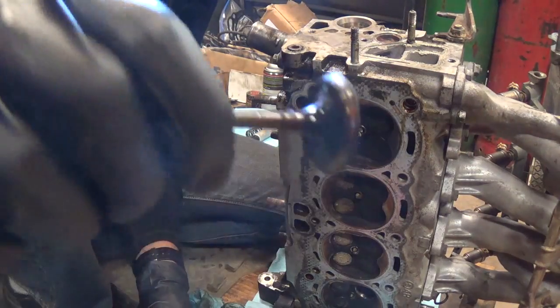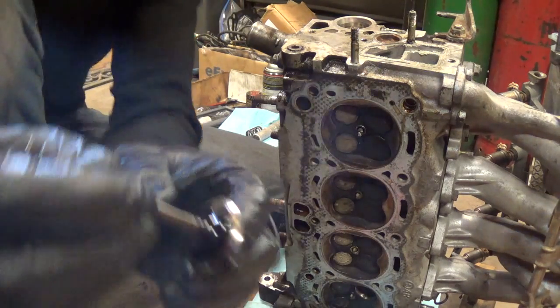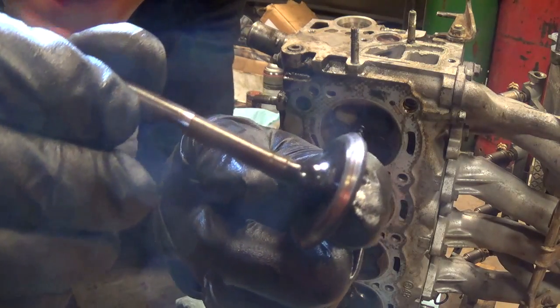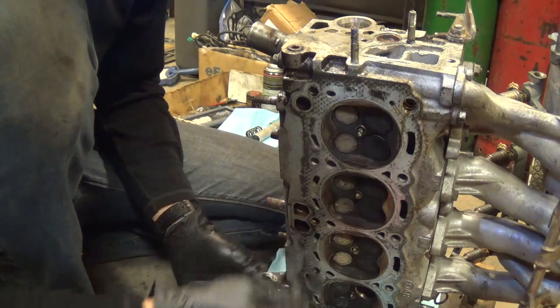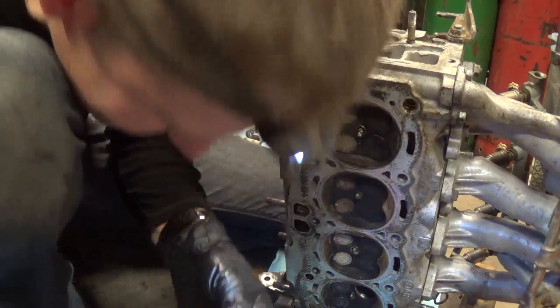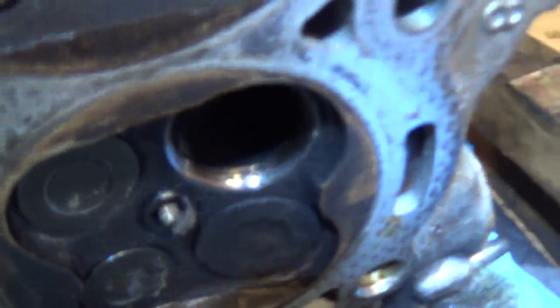Just for kicks, I took an intake valve out. I know you guys are going to say why are you only lapping the exhaust valves? Well, here's what the intake valve looks like - it looks beautiful. Look at that nice clean sealing surface. Obviously when the oil burns it goes out the exhaust valve - that's why the deposits are on the backs of the exhaust valves. The intakes are always cleaned by gasoline, so they actually look really nice. The seat looks fine too. No reason to do extra work here - see that seat looks beautiful and shiny. So basically just the exhaust valves.